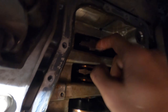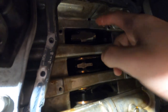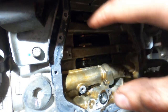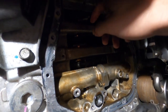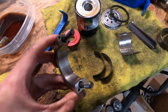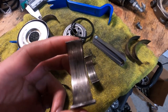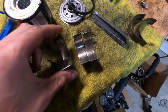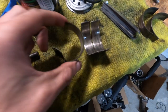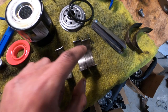So we're going to pull this rod cap off — it's just the two bolts. It might be a little bit tough to get the top one, but we got to get it off. And then we can pull the rod bearings out and work on getting the new ones in. There's really no metal shards that I can see, which is really, really nice. So we do have the rod taken apart and these are my old rod bearings — they are pretty freaking smoked. They're literally like broken and smushed quite a bit. Here's another rod bearing that's not as bad — you can see the size difference, how bad these ones got. These are literally broken off, so these are no good.